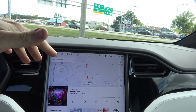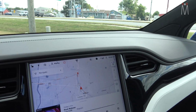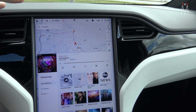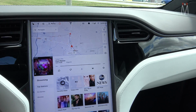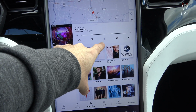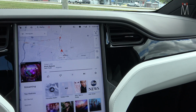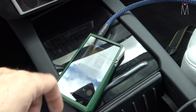And then that's going to take over. Another cool thing that we do is we have a switch down here. We can flip the switch and it reconnects our center channel to our factory MCU. That allows us to hear our turn signals, our autopilot chimes, our navigation, Bluetooth phone calls while we're using this. We just make sure we're not playing music here, and then we can hear that voice on the factory center channel. So it allows you to still have the functionality of the factory MCU while you're using preset 2 and preset 3.